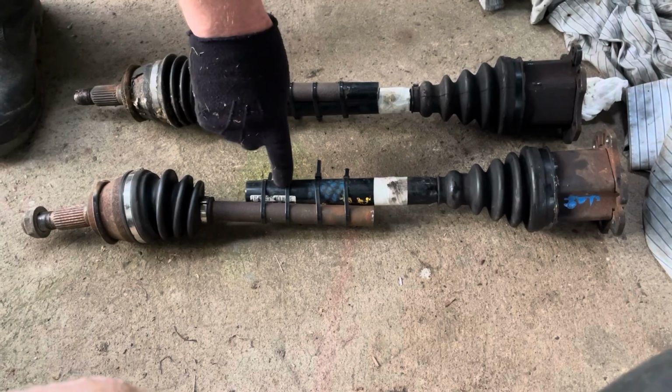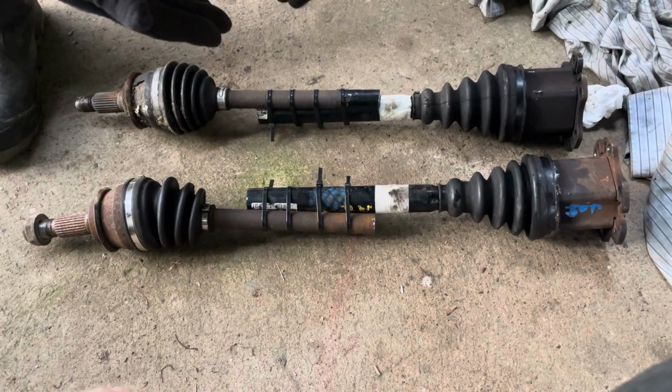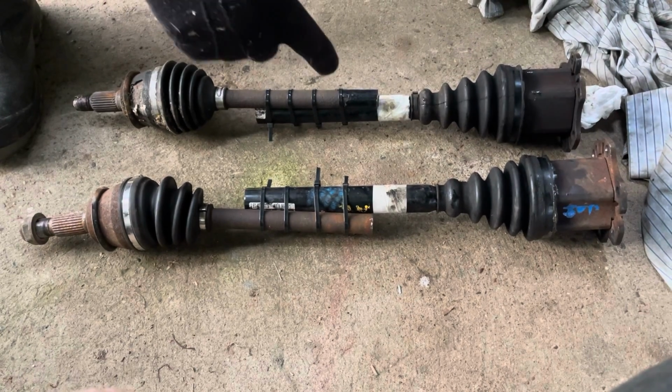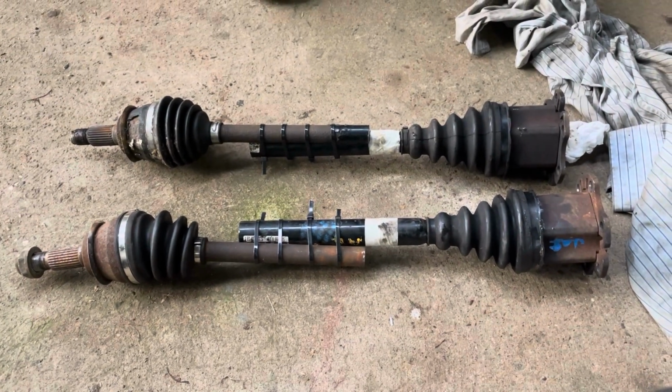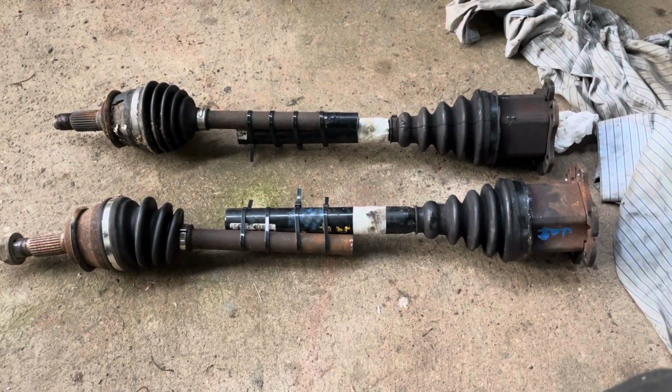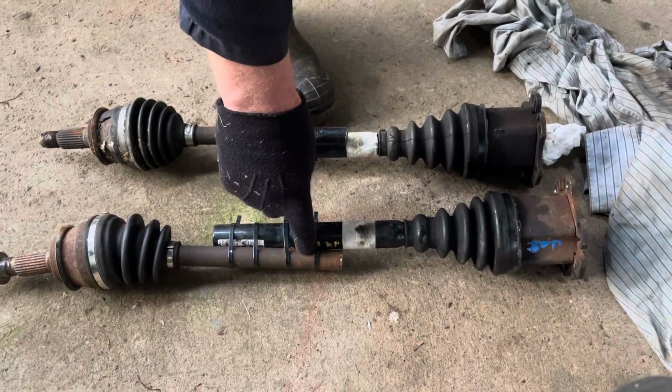Yeah, what I was wondering, if you had it three inches, say, then 2 inches down, if you drilled a hole in here with tapered edges, and you could do a plug weld in there, and then you make like a drive spigot. If you weld to this one, make sure it's welded to that.